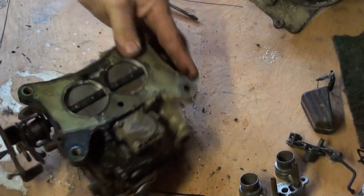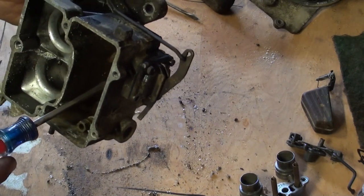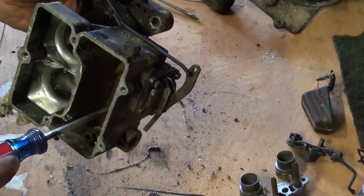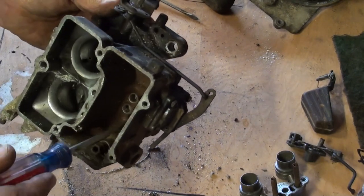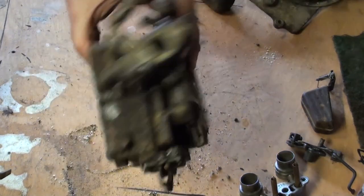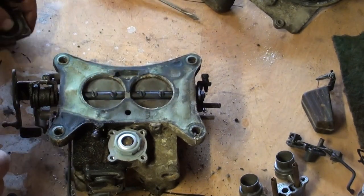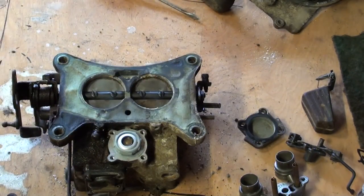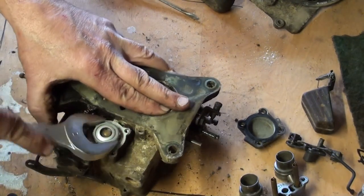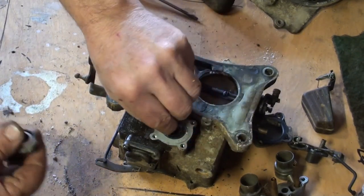Power valve. Jets — main fuel metering. Power valve: when you stomp at wide open throttle, power valve opens up, allows fuel to come underneath the jets, therefore bypassing them to get your maximum fuel enrichment. Just the cap, cover, housing if you will. Power valve — an octagonal or one-inch wrench. Nastiness. It'll run just fine — just put some gas in it.